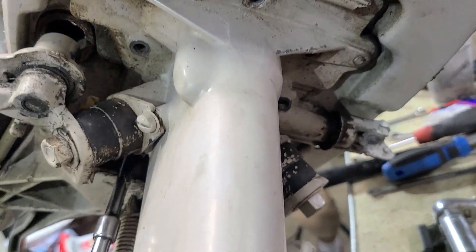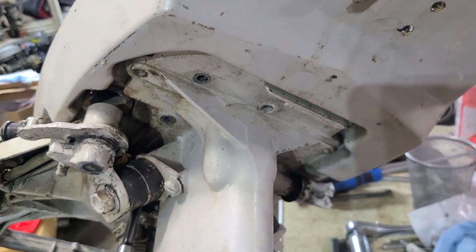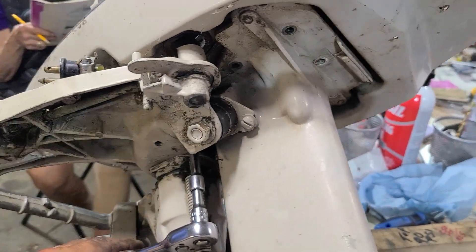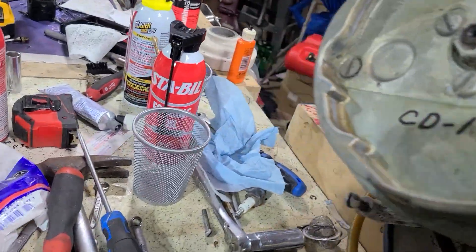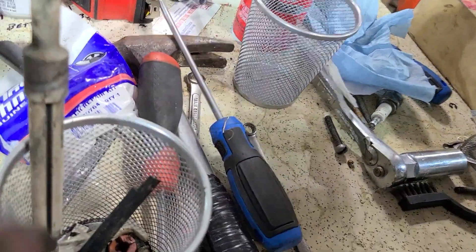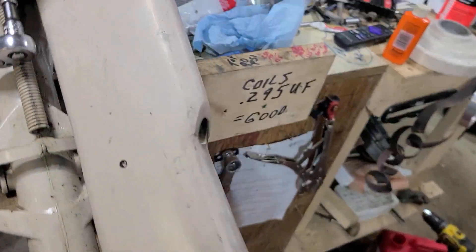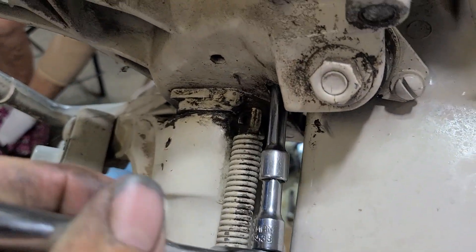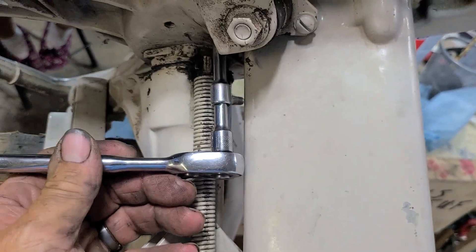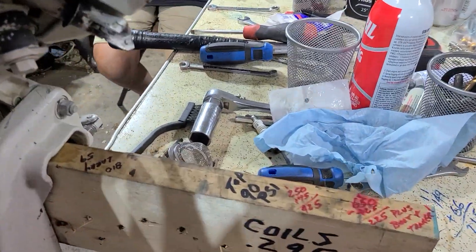Underneath here, on the older 5½ Johnsons there are seven bolts and they're all flathead screwdriver. But these happen to be hex head bolts and they are 5/16ths, with exception — I've found one at 3/8ths so far. This one is up in there pretty good, but with a couple extensions on you should be able to get it out. A quarter-inch drive, so it's smaller.